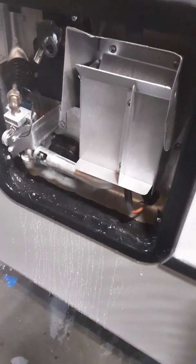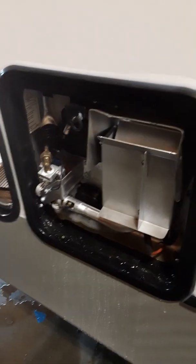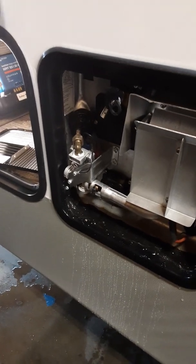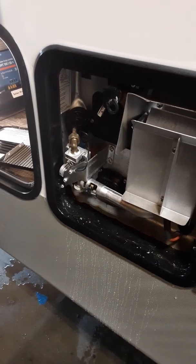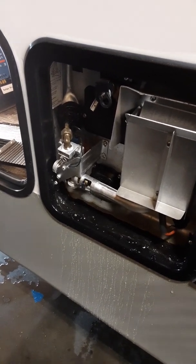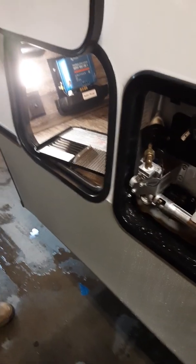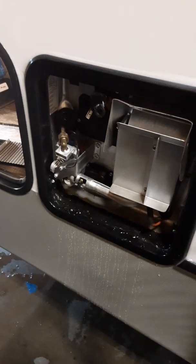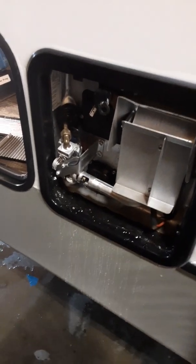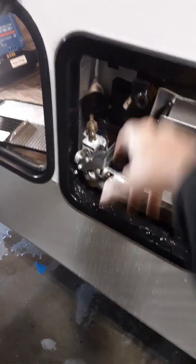If you want to empty it for the wintertime, you always want to make sure because you gotta get it winterized, or the lines could crack with water. We have to drain these so we don't fill them with anything. All we do is drain them, so there's no water in there because it's metal, the whole outside, so it could crack. So in the wintertime, that's when you empty that out. Then, when the new camp season starts, I want to make sure the water level's where it needs to be, so I would just test it by pulling that.